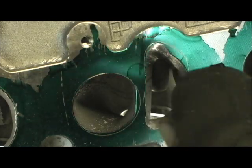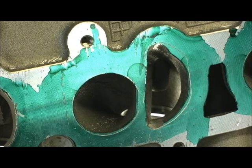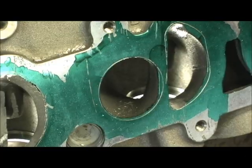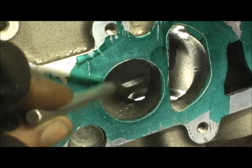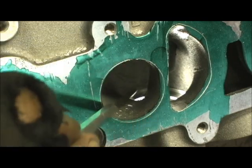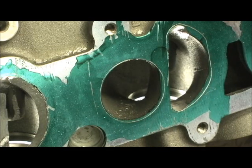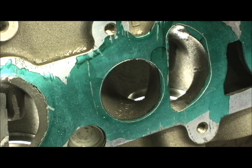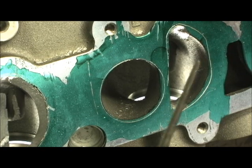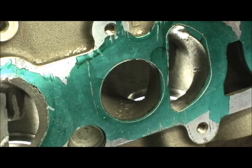If we can straighten that area out right there, pull that over, pull this down some, get it a better shot — and over here, it takes the form of a letter D. If I can go in here without taking too much material out and form that D shape — see, there's the flat side of the D and then the covered wagon. If I can go in there, pull that shape in and straighten it out, I would say the mod on both of these two ports right here might be about six cc's, maybe seven tops including the bowl work. In this game, it's not volume and size, it is sheer shape, trying to get the most packed amount of CFM without increasing volume, because we're after one primary goal: gas mileage.